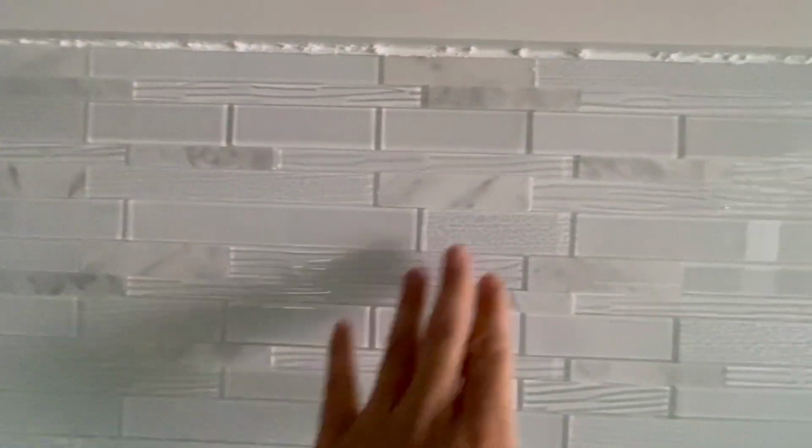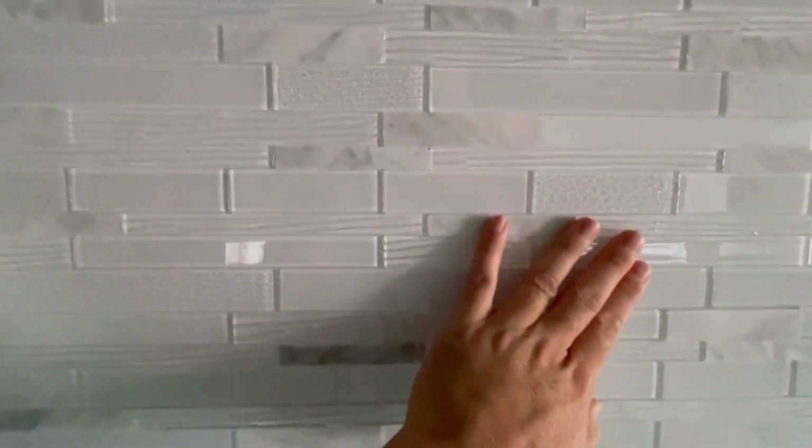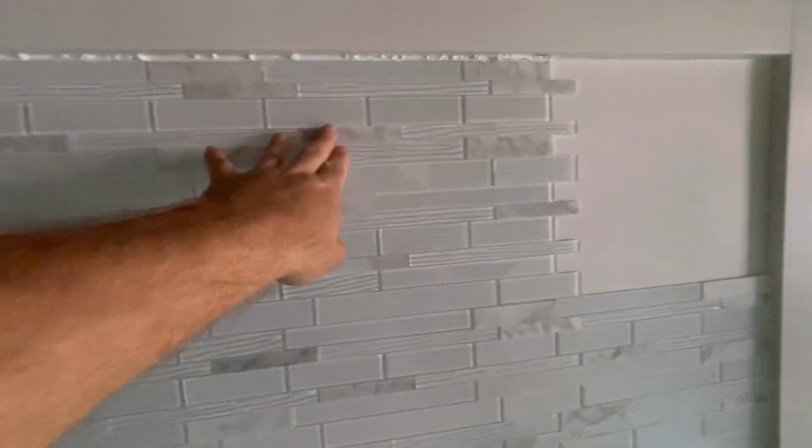I did the caulking. Yeah, see, all of these are stuck. They're not coming off. It's like the wood that's flexing here, not the tile. So I ran my bead of caulk around the outside here, and then when I went to wipe it with my finger, within maybe 2 minutes or so, because it was like 120 degrees inside the bus when I did this, it had already formed a skin over it. So when I wiped my finger, that looks absolutely terrible. We need to do that.